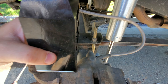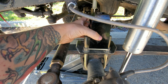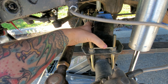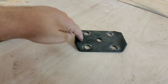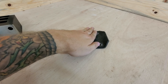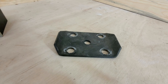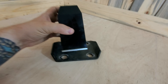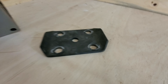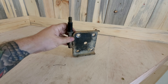So here's what I'm thinking: putting the bump stops right here in between the two u-bolts. This will be perfect so it can line up with the frame and be basically an extended bump stop. Here's what the u-bolt plates already look like — it's got this rectangular shape. I'm going to drill out the four holes so they're a little bigger than the u-bolt, that way we have some room to move around. In the new plate, the center bolt for the bump stop needs to be a little smaller so it can be tighter on there, and then I'll secure the back with a lock nut.